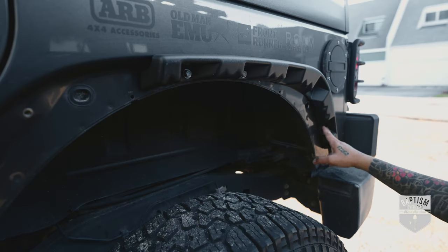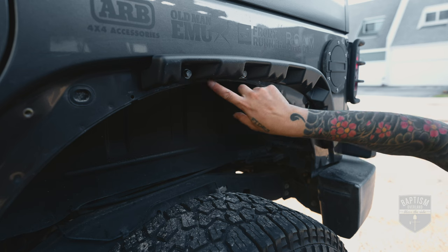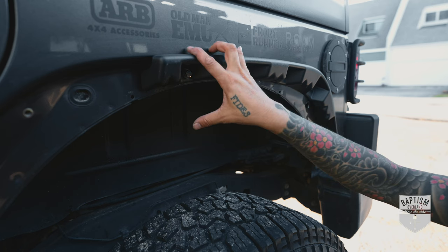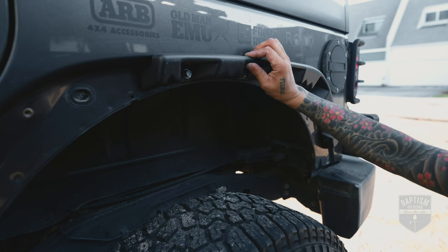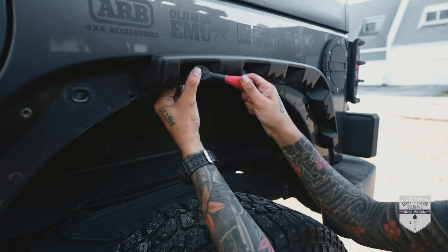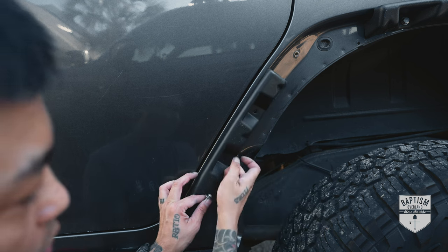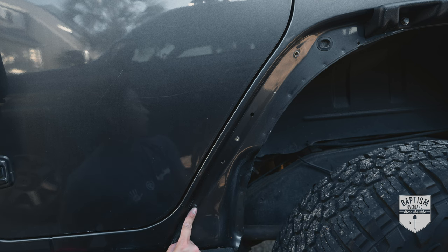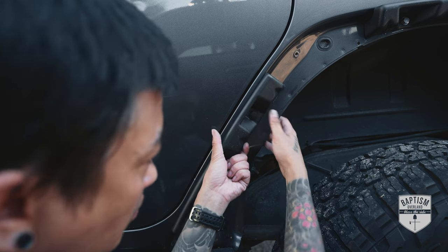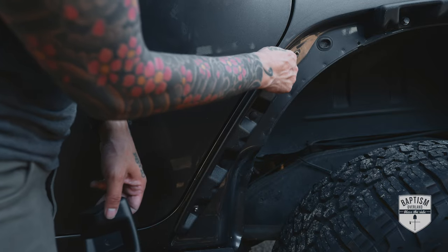Now that those three are secure, go ahead and tighten down these two bolts. When tightening, do not over-tighten to the point where the plastic starts to get deformed at the bottom — if that happens, you're going to have a very hard time putting your fenders over it because it's going to bulge. You want it tight enough to hold without moving, but not so tight that you squish the plastic and it becomes deformed. Moving on to D5 — this is the front of the vehicle for reference. These are also push pins. Line up those holes. I was lucky enough to have a rivnut here, so I'm using a bolt, but normally you'd use a push pin. Last but not least is D9, which goes right here — that's also a push pin, but I also have a rivnut there already.